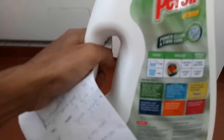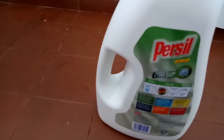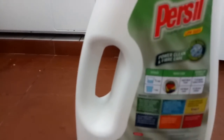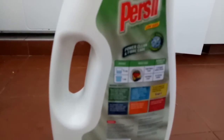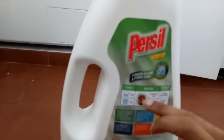I have to make a mention about the detergent. Whenever you're buying detergent, it should be what's called a low-sud detergent or powder. It needs to be the front-load type of detergent and not the top-load detergent, because they're both different types and the top-load detergent doesn't work well in the front-load machine. So look on the back of your detergent before you buy it to make sure it's low-sud and it's that front-load detergent.